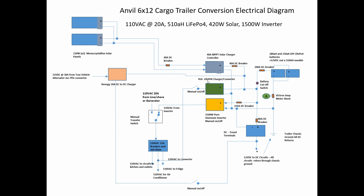I've got a 45-amp lithium iron phosphate charger/converter that will provide 45 amps either to charge or to run DC circuitry. It has a manual on/off switch and normally gets its power from a generator or from 110-volt AC input. One important caveat: you do not want this thing running from the inverter — that creates a big loop and will run the battery down. You could add a relay to prevent that, but it adds complexity. Honestly, I very rarely use this — the solar does its job.